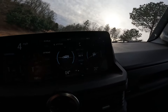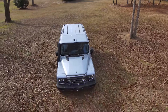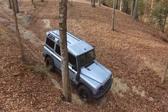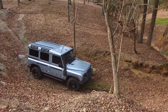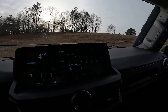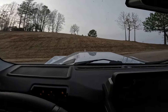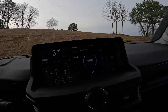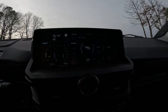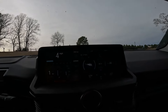I definitely feel comfortable in this thing. When I go to the Overland Experts training in a couple of weeks where I'll be able to video, I think we'll test the limits. Now we're going to drive my car — we're going to test them to the limit I'm comfortable with, because if the car rolls, that's on me. Now we're going to try the pitch. This hill coming up is going to show us something about approach and departure angle, and also about pitch. I fiddled with this a little bit yesterday and I think it went to 25 degrees. You see — 19, 24, 25 degrees — just for a second there, and it still had room left on the gauge.